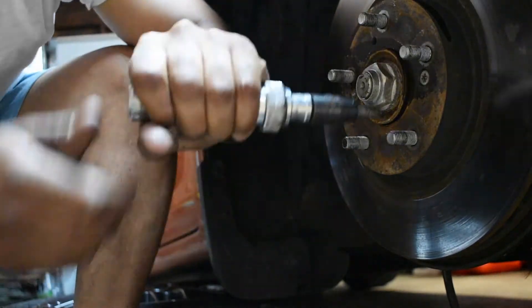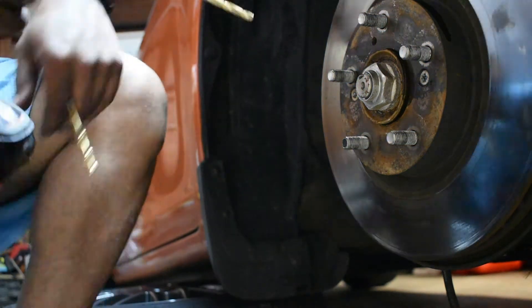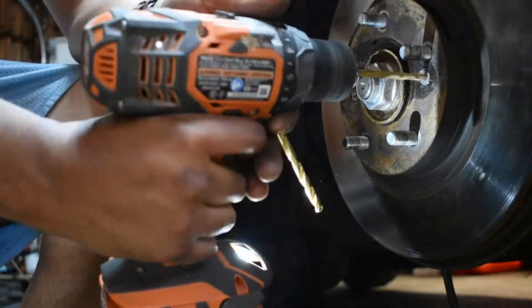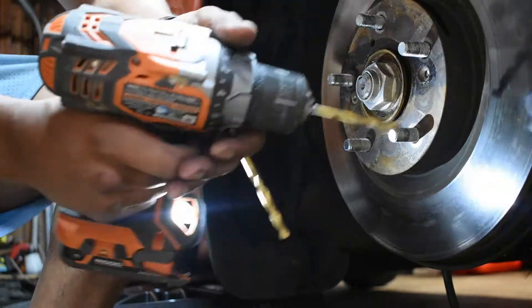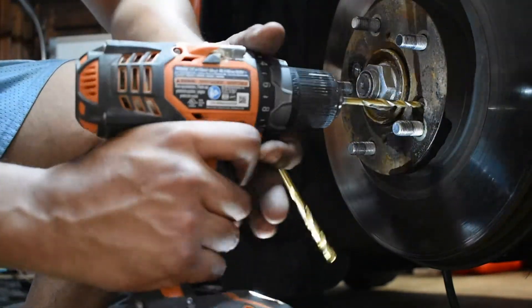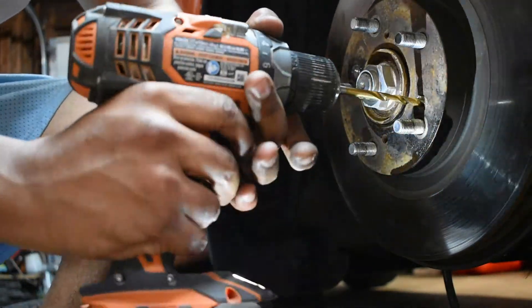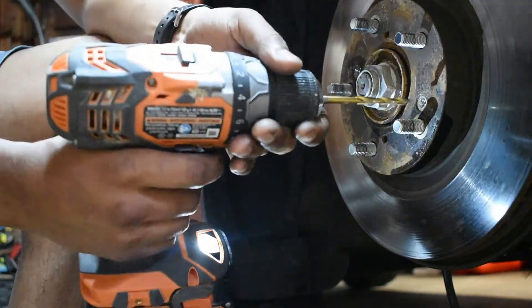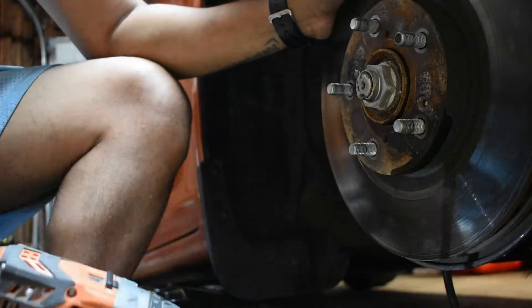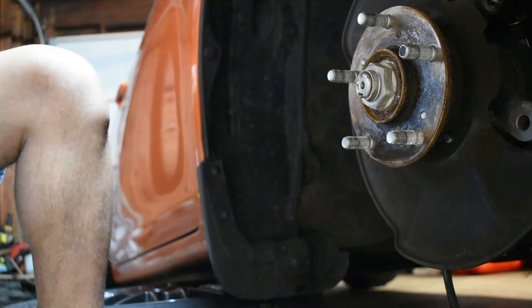At this point I'm fed up, so I pull out the drill and a couple of drill bits and just go for it. The head came off — if I had put it in reverse a little sooner I could have actually reversed the screw out, but not a big deal. Once the head is off you can get the entire rotor off and then work on getting the threaded screw remnant out. With a smaller bit, the screw did come out — you don't want to leave that in there if you don't have to.